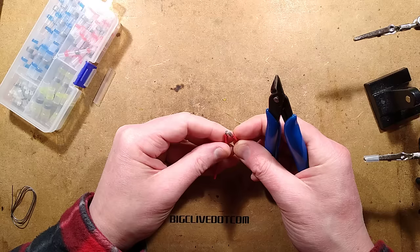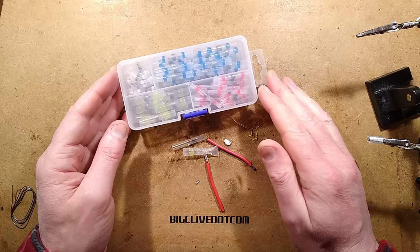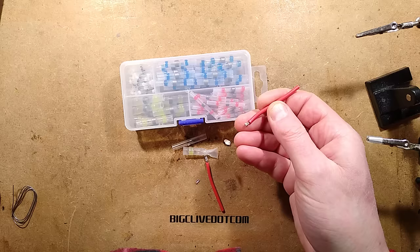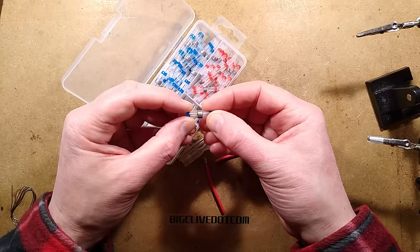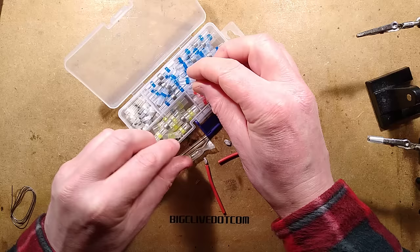There's so much more silver in that - it's all the way through, which is what you'd expect because of the amount of solder I flowed in. I'm not even going to have to crop that up the middle because I know fine well that it is solid all the way through. So the answer is that these things work - they're probably more convenient than butt crimps, but they're not as good for high current carrying applications. I'd rather solder it with a proper soldering iron, but it may at least get you out of a tricky situation, and in certainly low current applications it could be enough to do the job completely. For long term use, I like the fact that it has the hot melt at the ends that actually closes in and seals around the cable. Not convinced that for very large cables the little band of solder in there would do an awful lot, but for smaller sizes it's probably more than enough. Interesting things, and to be fair they do work.